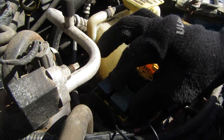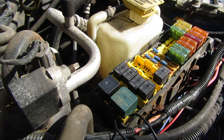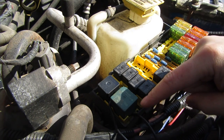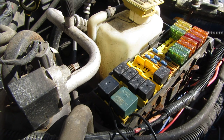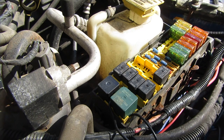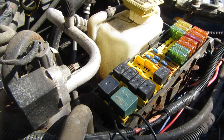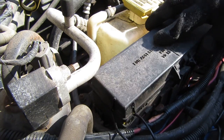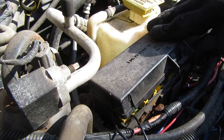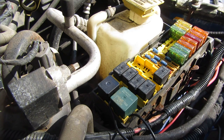What I did was I just popped this relay out. I took two wires, stripped about an inch off of the insulation, wrapped them around the top of the posts — on the 30 and the 87 that I needed — then pushed this relay back down in and it worked like a dream. There are definitely other ways you could do it — you could solder in the back or use piggyback clip things that break into a wire. This way seemed pretty safe and secure. I also cut two little slits in the cover so that it would still fit down securely over those wires coming out. Now that I have the 30 and the 87 coming out, I was ready to wire in the actual time delay relay.